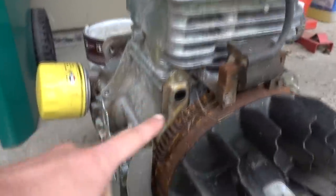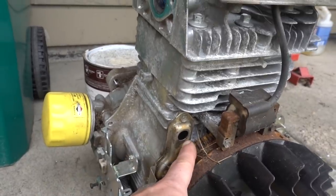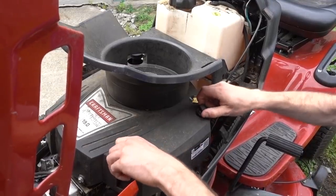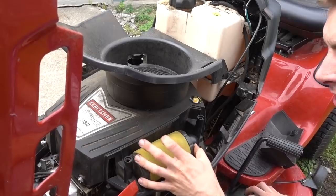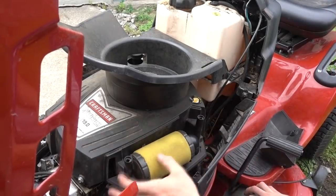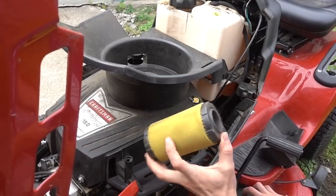What I'm talking about with the vacuum is on the one that I put in there. The vacuum, I think, comes somewhere out of the engine, somewhere out here, where this one is right here. So what I think the issue is, is the piston rings are just shot, because the engine that I put in is older than the other one, and it had a bad carburetor seat and needle, so gas was leaking from the carburetor into the engine over time. With that gas in the oil, if you ran it at all, it was just wearing it differently.